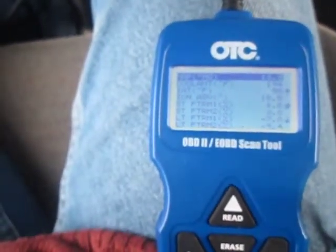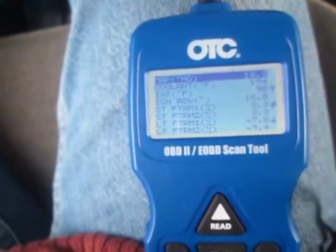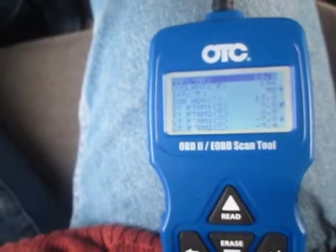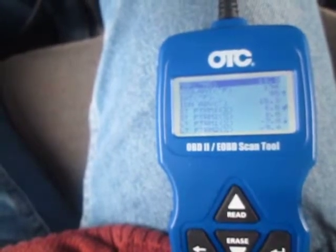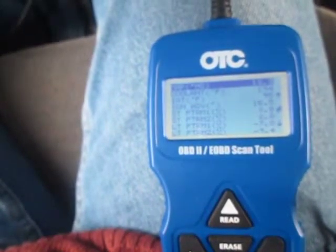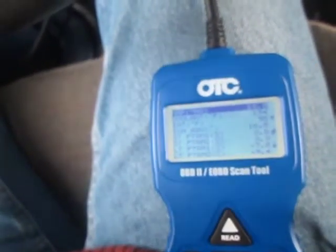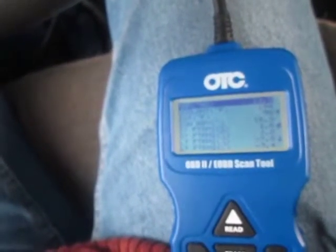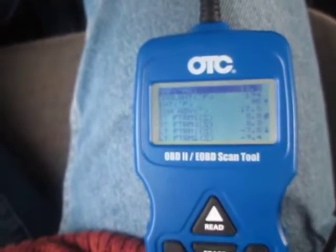The spark plugs are AC Delco iridium — about $6 spark plugs. Spark plug wires are new, distributor cap — everything is new. The car idles very fine. Fuel pressure holds up for 2 to 3 days without going to zero, so I tested for a leaky injector and couldn't find any clue that there is one. I couldn't change the fuel filter because it's in a tight spot, but in the summer I hope to drop the tank to change it — that's not ideal but there's no way around it.